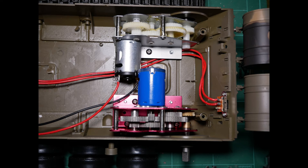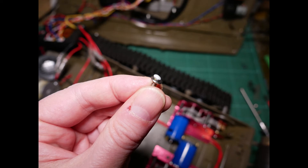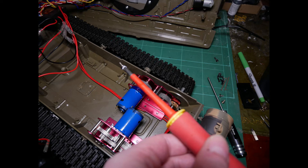Using the same three screws, fit the new gearbox. These gearboxes are usually heavily magnetised, so adding some blue tack to the screw head will help when refitting the screws. Be careful not to over-tighten them though.